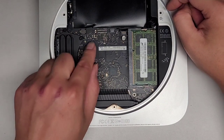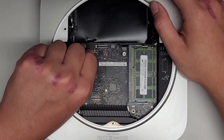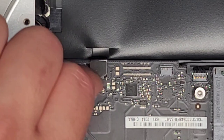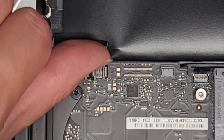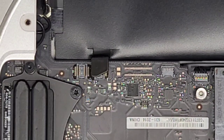Next thing we're going to do is push or pull the whole motherboard and everything out of here. There is this connection for the power supply, but we can't remove that until we pull the rest of everything forward. I'm going to disconnect the hard drive for now — just flip this up. This has a press-down connection, so I'm going to get my fingernail under there. You can use a plastic pry tool. So we disconnected the hard drive.